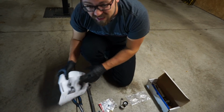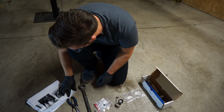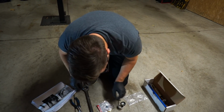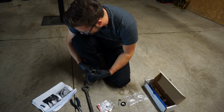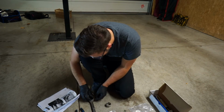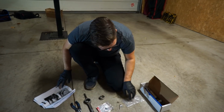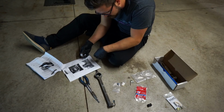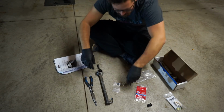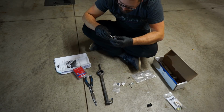Okay, next part. UUC is giving you some very handy instructions. So we're going to install the pivot height adapter assembly, done on the workbench. Well, this is my workbench, so that's where we're at. It says, put that little guy up. Okay, that slots in there. Is that thread locker? Yeah. So, thread locker, a little bit in each hole, makes it easy.